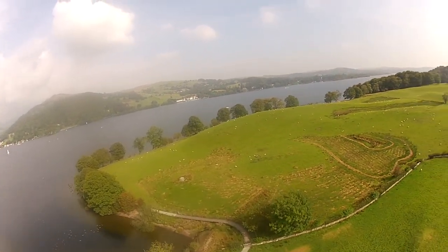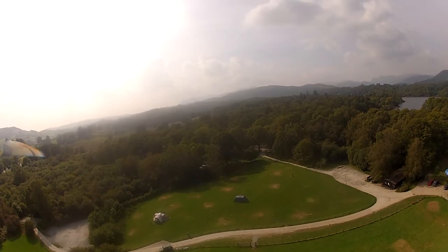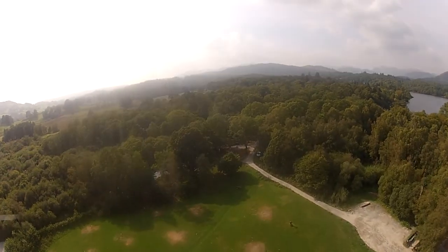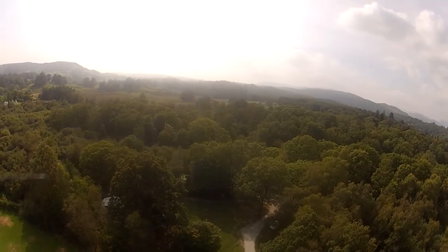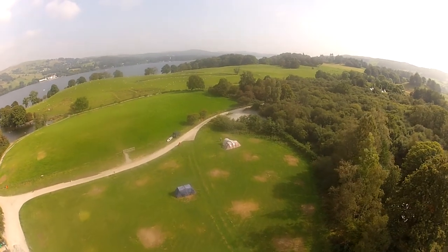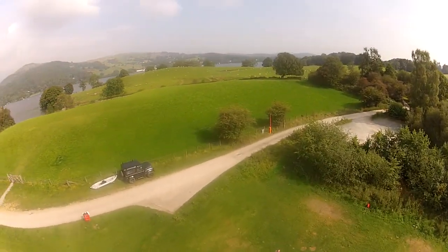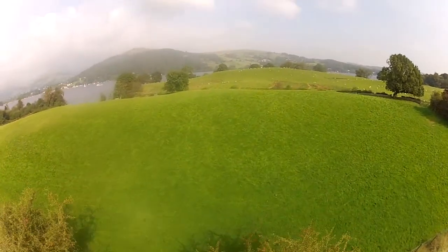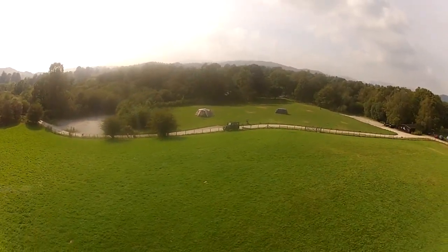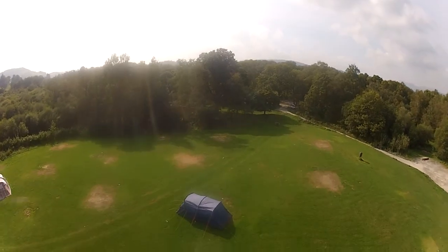This was supposed to be just a quick test of my H-copter. I'd had it flying in the morning and it just did not fly that well at all — a little bit erratic. It seemed fine in the air but I had no confidence with it whatsoever. It seemed to drift in height and would not return to its altitude. In attitude or GPS mode, I noticed it never really got a GPS lock. I'm not sure if that's to do with the glare from the water — it certainly wasn't a cloudy day. It may be some kind of interference from my FPV equipment or the wiring.